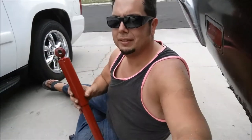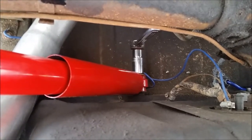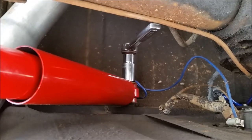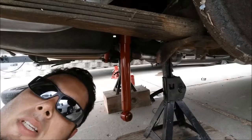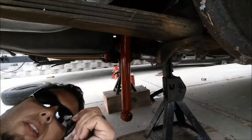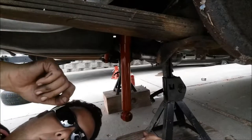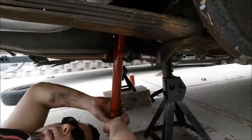Worth noting: before you attach the bottom, don't tighten the top fastener all the way — it gives you a little extra room to swivel and move it around. Once the bottom is finished, tighten the top just to where the rubber starts to bulge; you don't want it too tight, and it really won't get very tight because of the thick rubber bushing. I did notice on the other side the top just had a flat washer and nut, while this side had the same two curved washers top and bottom. Whatever you have, deal with it — if it's from the '60s it's probably been replaced once or twice since then.